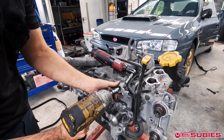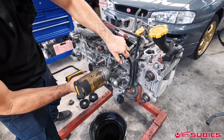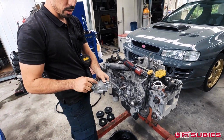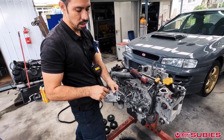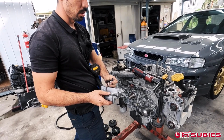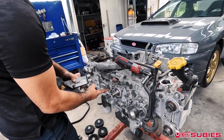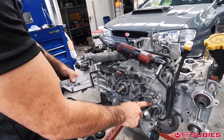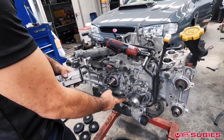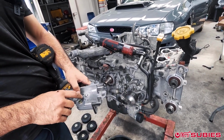This is really cool that Subaru does this because one, you can upgrade to newer tensioners that have like another pulley here. But also, if you for whatever reason ruin the tensioner's threads, don't panic. You can actually pick these up for pretty cheap and still get your timing belt job done. Just not necessarily the case for the other pulleys, except for the one that's on the water pump. So these two are part of the block. Careful with those. This one, technically, also fails. You can replace the water pump, and then the main one is the tensioner in itself.